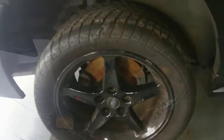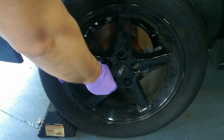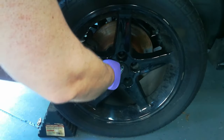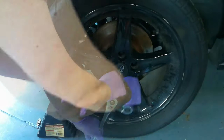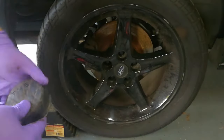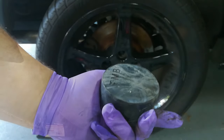If you don't have access to power tools, you want to go ahead and break the lug nuts loose on the ground before you lift it up in the air — just break them loose about a quarter turn each. I'm going to be using a floor jack with one of these hockey puck style adapters underneath the differential and I'll be lifting up the vehicle.